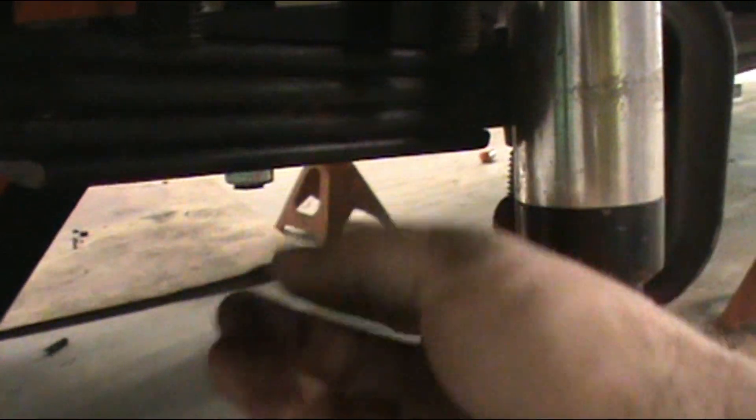And there it is installed — that's our six-degree shim on top of the pad. This pad will come down and sit right on top of that, and then we'll tighten up our U-bolts. I already cut off the excess length, she's all tightened up. We can take these C-clamps off now and start putting her back together and take her for a test drive.